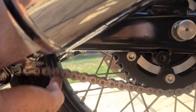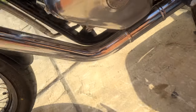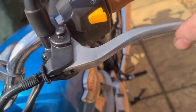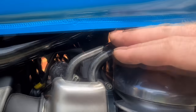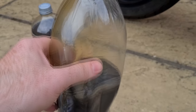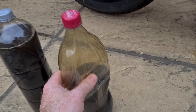Turn off the engine, let it sit for two minutes and recheck the oil level. While you are here, check chain tension, tyre pressures and condition. Check wheels and spokes, all nuts and bolts, brakes and pads, shock condition, clutch and throttle free play, all vacuum hoses, brake and fuel lines. Make sure you dispose of your old oil at your local recycle centre or take it to your local garage. You can see the 300 mile running-in oil is very dark — a job well done.